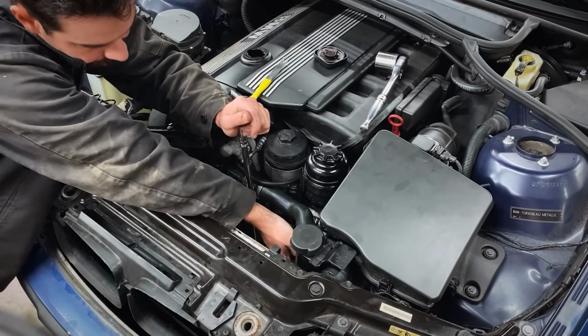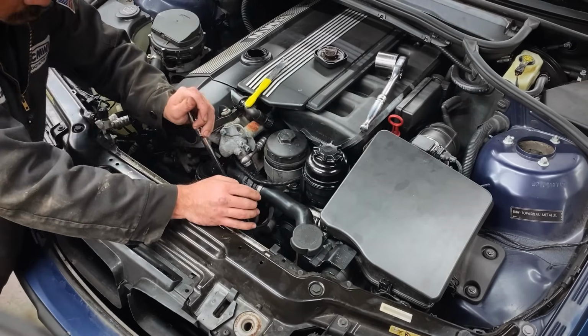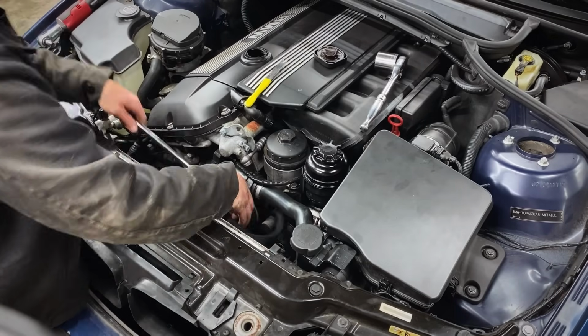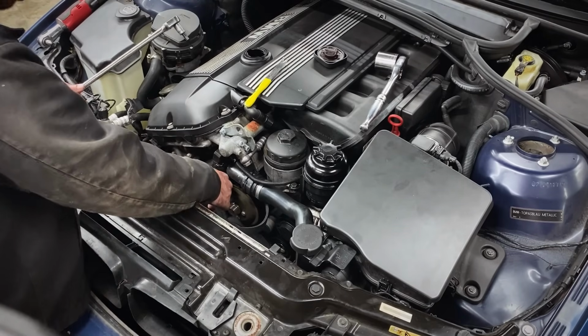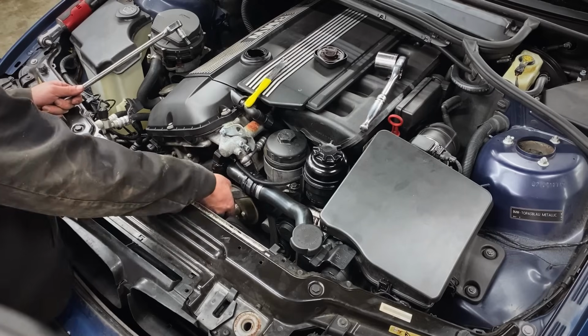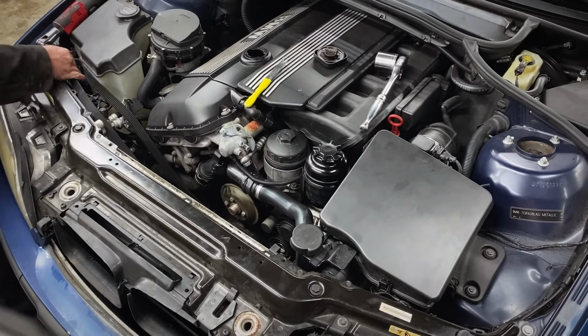Slip the belt off, either the alternator, the idler, wherever you can fit your hand down. Release the pulley. Take your ratchet out and then just flop the belt off. You can take it just off the power steering pump if you wanted to, if you don't want to lose the diagram. I like to take it off like this and just flop up over here to the left out